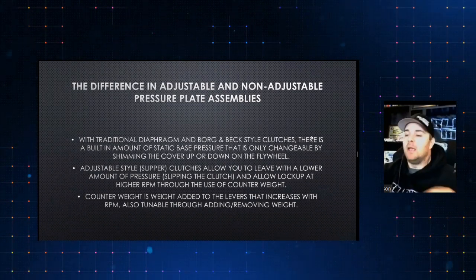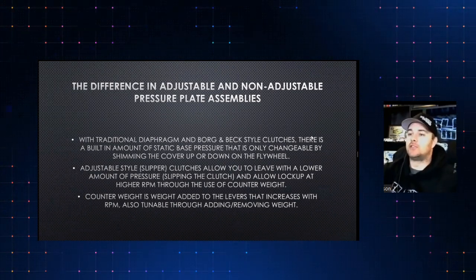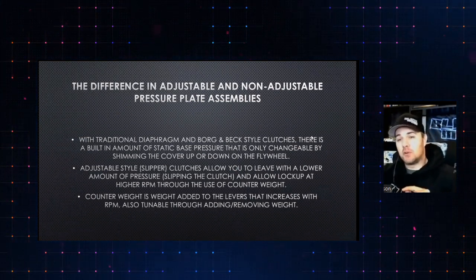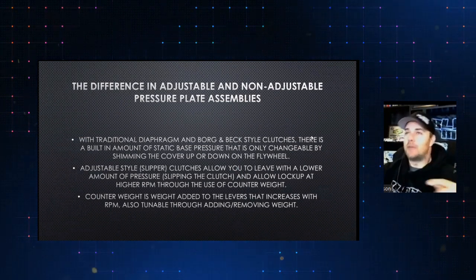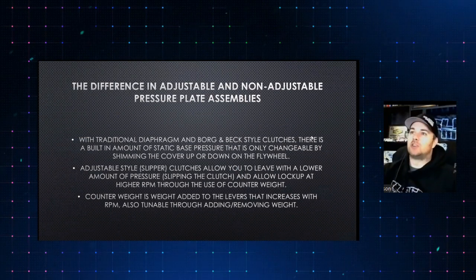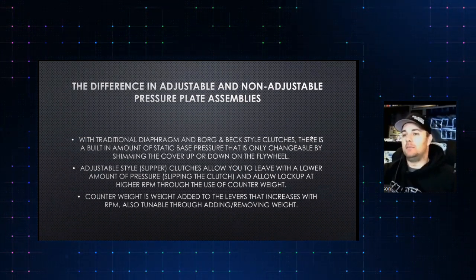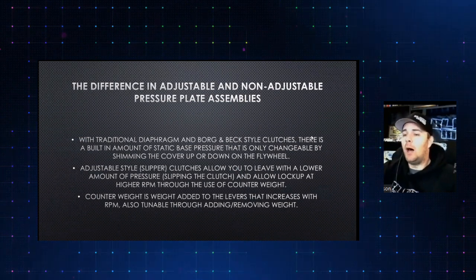And that's where we determine that shift point is going to be different between a 4-speed or a 5-speed, big time. Obviously a 4-speed has a lot bigger gear drops, and in having bigger gear drops, it's going to drop lower. When it drops lower in the gear change, that also gives it an ability to slip the clutch more because it loses that RPM. So that's why you'll see 5-speed applications are more advantageous than a 4-speed, not only because you obviously have better ratio and better leverage to the track, but you also have the ability to tune the clutch in more precisely to what you want.